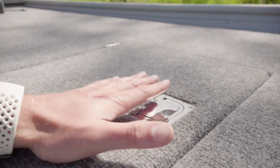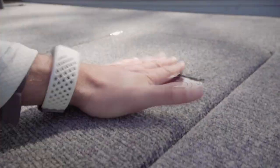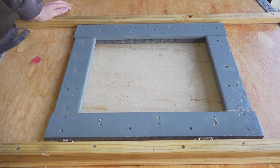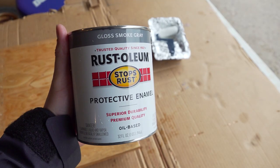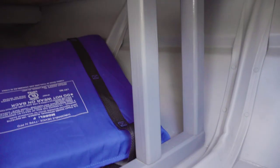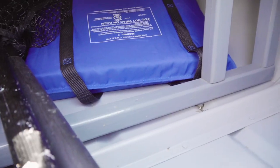You can just step on this and I don't have to worry about these little lips — the deck just rests on them. I can put all my weight on this, it's not going anywhere, and it overlaps on every corner by about a half inch to three-quarters of an inch. I painted these with some gloss Rust-Oleum to match, and these are also Rust-Oleum painted two-by-twos bracing the weight on the weakest point of this boat deck.